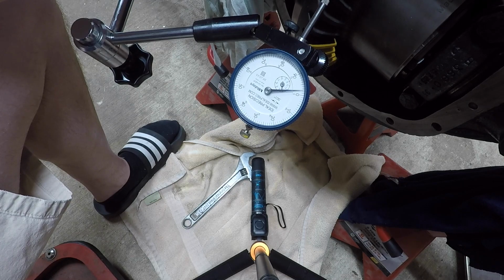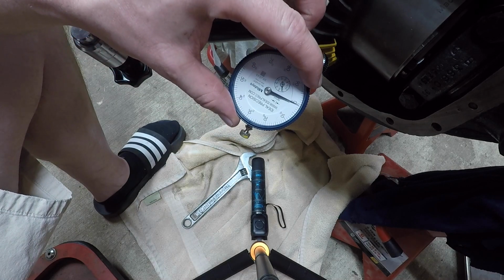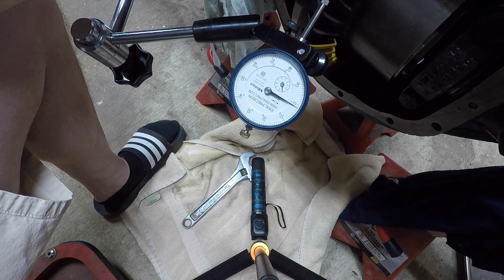That's why it was so important for me to do a voiceover and explain to you all how pinion bearing preload should be set up before you even start putting the ring gear in and searching for your pattern. And it was at this point I was like, no, something's just not right here. All because pinion bearing preload was not exactly explained to me. It took me probably 15 to 20 times taking this thing apart to try and understand what is going on. If pinion bearing preload was explained, I wouldn't be in the situation that I'm in now.